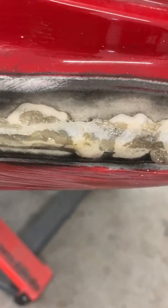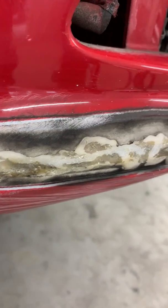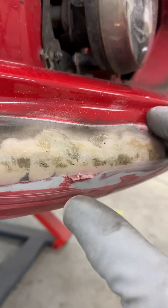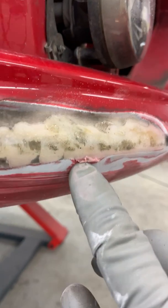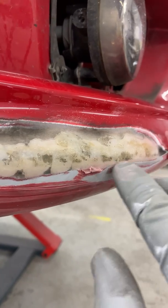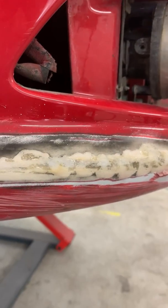The new weld is quite hard but you can see I am knocking it down. I probably could have gone with a P60 to start with, but I've only got P80 with the extraction system. The new polyurethane rod has not adhered to the paintwork — it never will. I know I overlapped onto the paintwork a bit, but it's not an issue because this is just excess anyway. The bulk of the repair is here, and that's where the strength is. We're going to continue sanding this back until we've got polyurethane onto polyurethane.